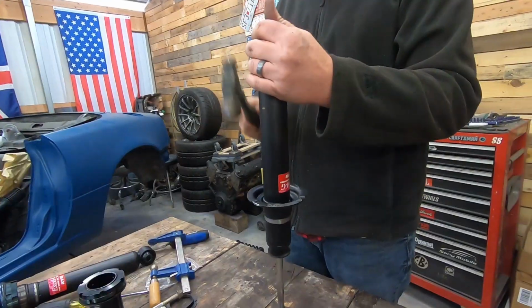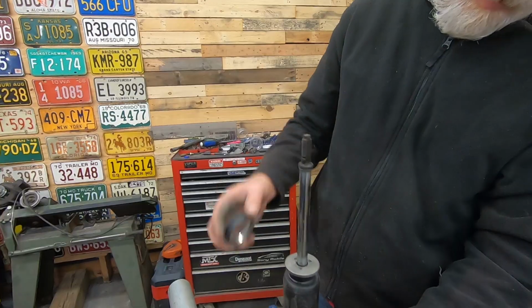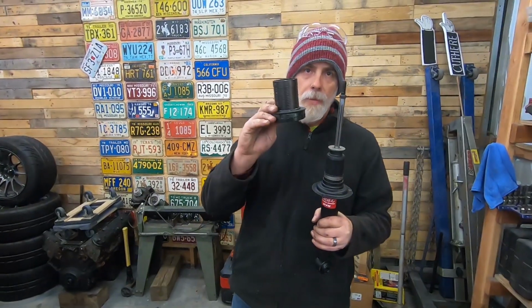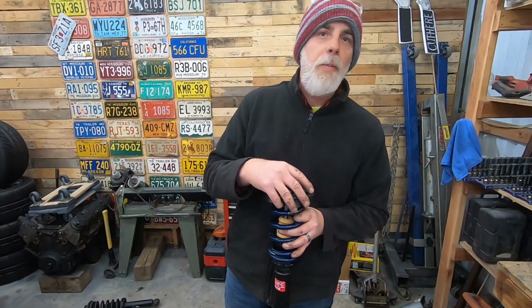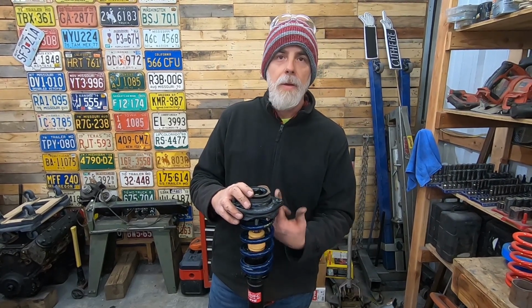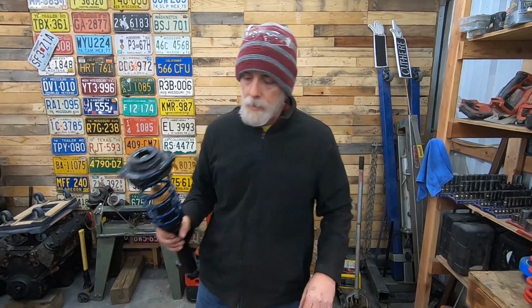So to show you how we made these, the first thing we did was we took the spring perch off and then we cut it. And after we cut it, we cleaned it up with a file a little bit, flipped what was left of it over and drove it back down onto the shock. And then at that point, we were able to put this on, slide it down, slide the springs on. And we do not have spring compressors, so we had to get real creative in the car and use the weight of the car to drive the ram up, the rod up through the top hat and bolt the top hat on. But we'll show you guys all that. But this is how we did it. Might not be how you want to do it.